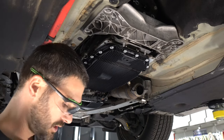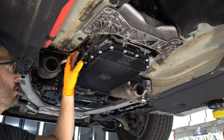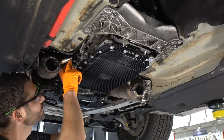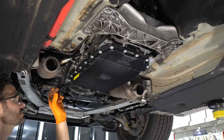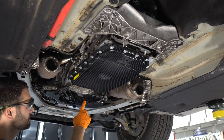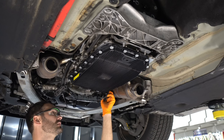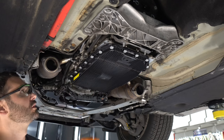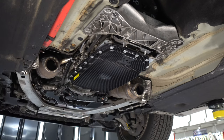Now that we've got the drive shaft removed, we need to remove the shifter linkage. The O2 sensors are routed and clipped to the side of the transmission, so we'll have to remove some of the connectors — possibly the O2 sensors all the way. The engine speed sensor is here and will need to be removed. The tranny cooler lines are up on the right. First, let's take the shifter cable off — I think it's 10 millimeters.